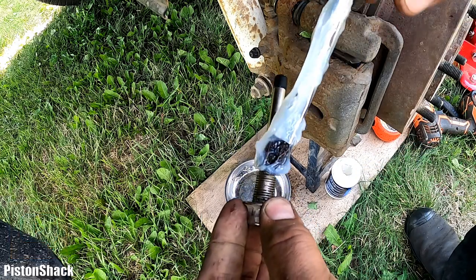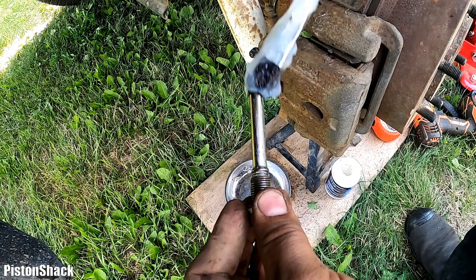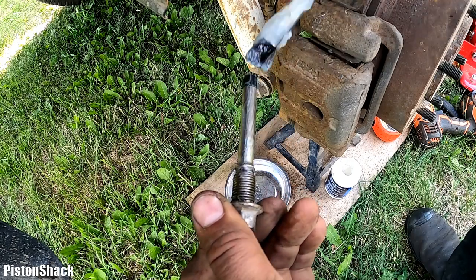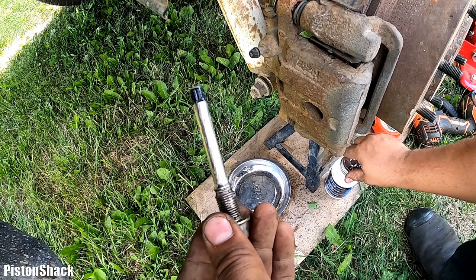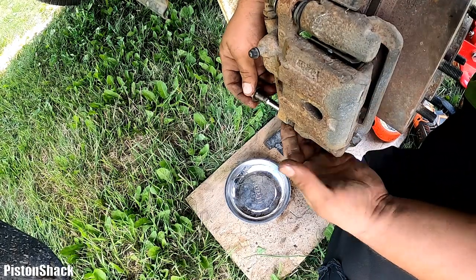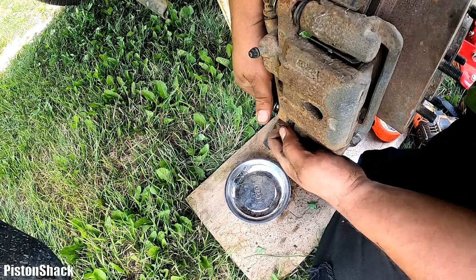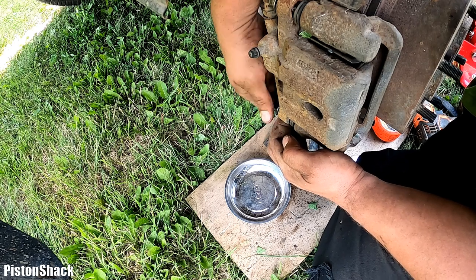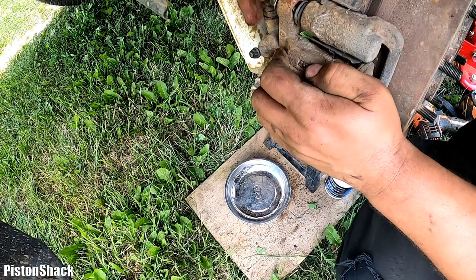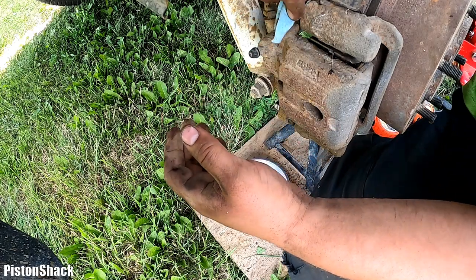Okay, very light coat of grease. Why we're using a silicone based lubricant, because it's very gentle on any rubber components like the boots, and handles the heat pretty good. Okay, that's it. Doesn't need more than that. All right, let's do the bottom one. Just make sure it's going through to the boot. Here we go. Nice and easy. Run my hands, check, make sure the guide pin rubber boots fit properly over the guide pins, over that lip, and there's no gap. That's very important, otherwise dirt and debris and water will get in.